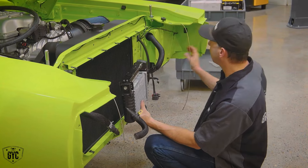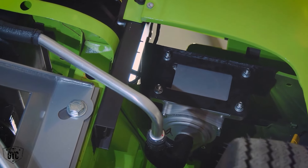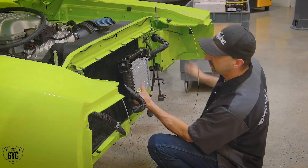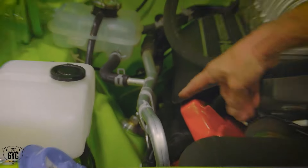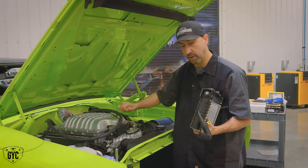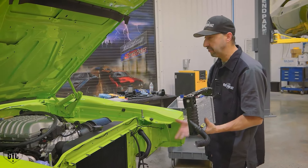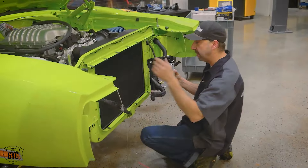What I ended up doing was I mounted the 12-volt pump up here behind this headlight area in the '70 Dodge Coronet fender. I got my hose, cut a hole here, got my hose coming through here. So what it's going to do is go into this, come out of the cooler, go here, then cycle back in up here — you can kind of see where these hard lines are. I utilized all the factory lines, all the factory clamps and everything, the factory bottle, the whole nine yards. I'm utilizing every little piece that Mopar gave me. I'm trying to use as much of their hose as I can, as many of their clamps as I can. So I got both of my lines in here — my in and out set up.